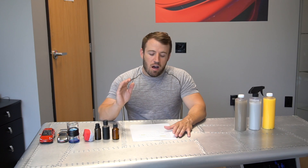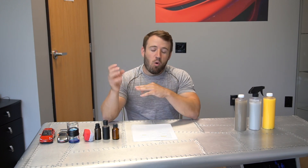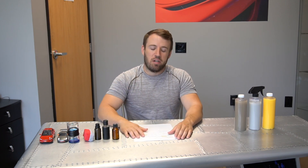Durability is substantially better as well, and so is water repellency. The sliding angle is actually lower, meaning not only are water beads taller and sharper due to the coating being more hydrophobic, but the angle needed for water to evacuate from the surface is reduced. This means water beads up bigger and removes from the surface a lot faster. When washing the car, you'll notice a lot less water sitting on the surface than with a ceramic coating — it's easier to dry, easier to clean, and it self-cleans when it rains.